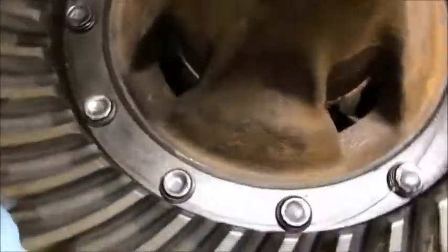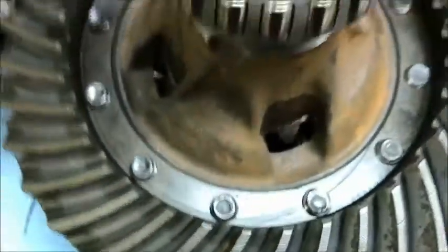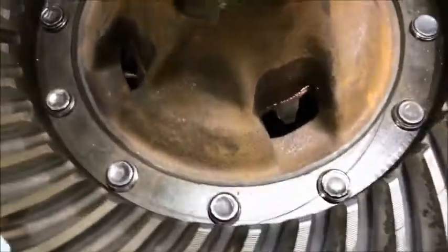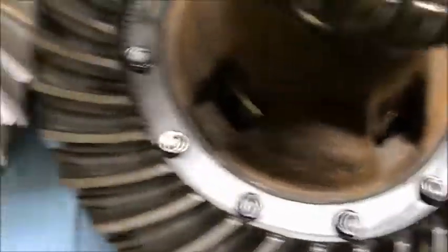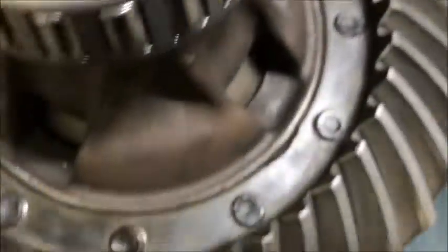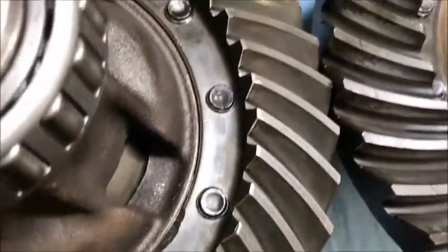I was noticing this one here is actually quite rough on the inside. You can see the tool drag marks from when they machined the surface — they dragged the tool back across as they retracted to the home position. I'm just surprised how ugly this one is — look at that chatter. This one is probably dated 1966, this one here dated 1970. But look how clean the 1970 one is. Between 1966 and 1970 they totally eliminated the tool drag marks and the chatter — this one's so much prettier.